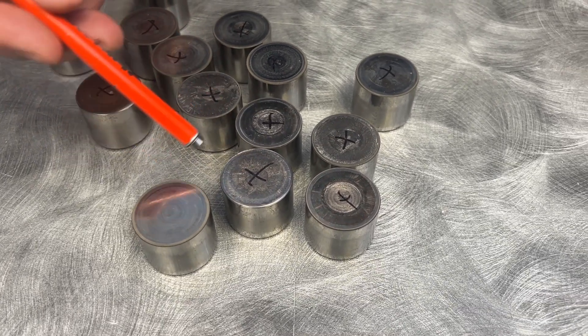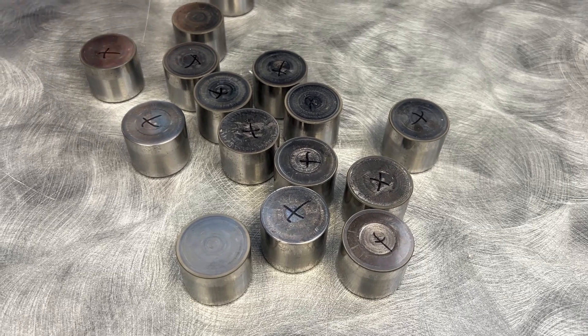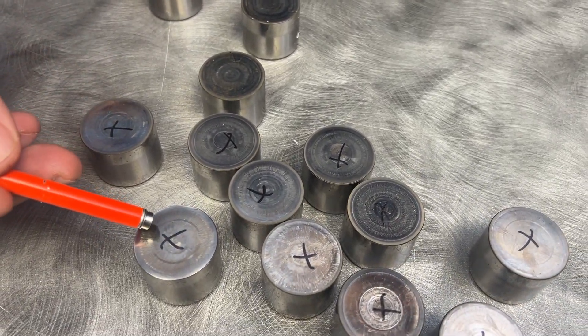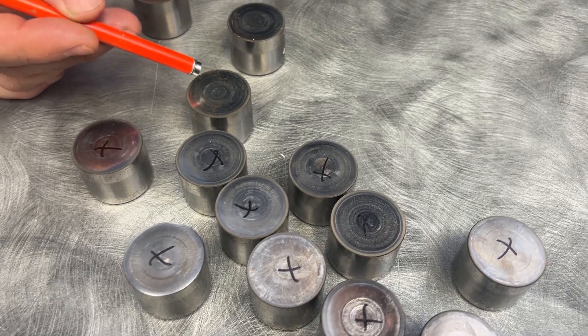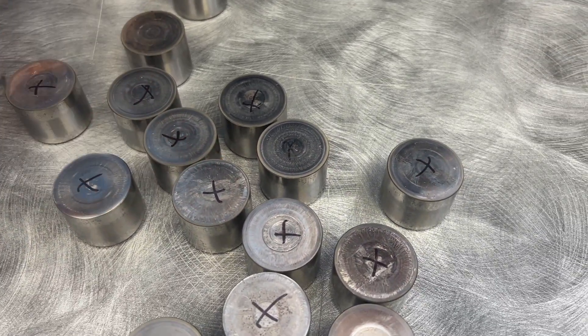An S2 has actually set the world record at 7.50. So for you guys who think you need big cams, here is a perfect example why you don't need them. But the issue we're seeing here is all these buckets have a lot of wear, and only on the exhaust side.